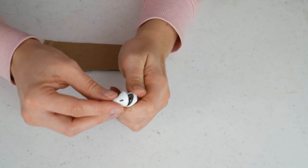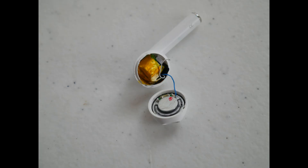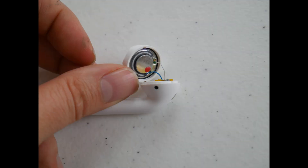To get these open, I had to twist it counterclockwise like you see. Initially I couldn't even get it open — I had to pry it open. When I pried it open, I noticed that one of the wires had fallen off the speaker, so the speaker was the problem. If you open it up and both wires are attached, try our video in the link down below — this solution won't work for you.